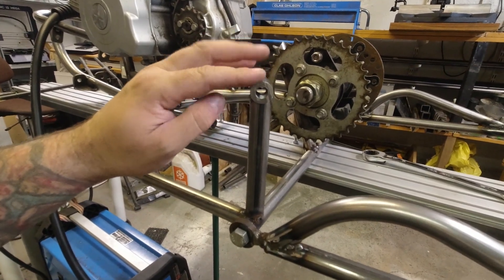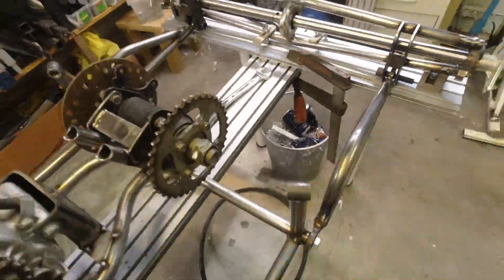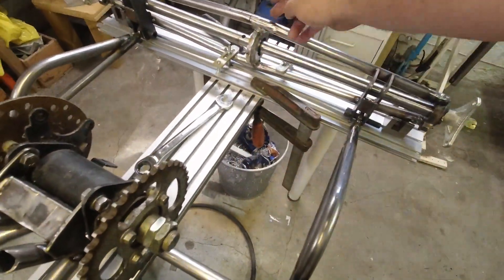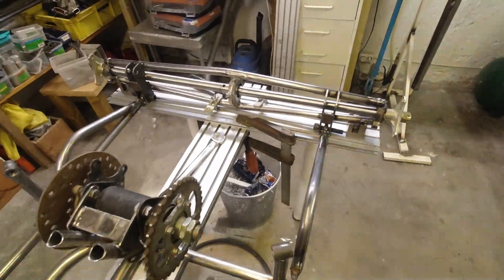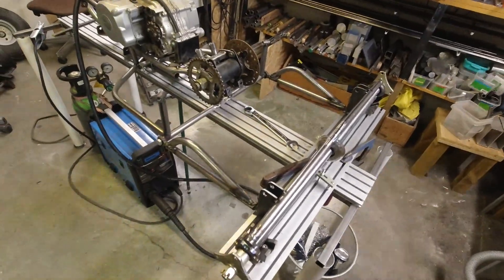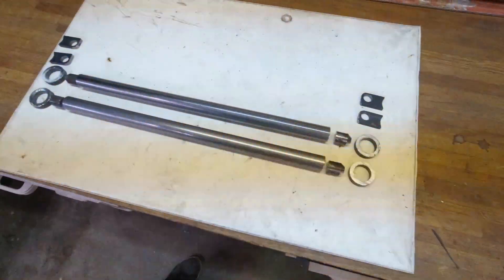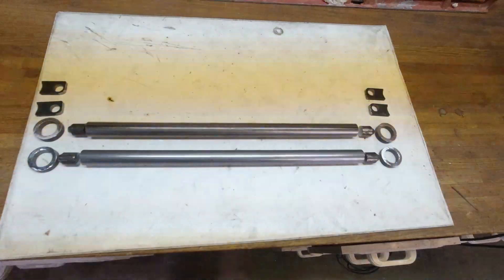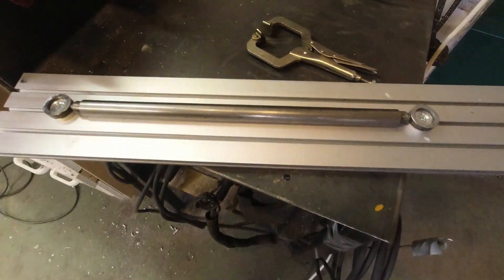The upper mount on the chassis, I just tacked it there to try it out — and there it is on the other side. I angled them almost towards the center of the rear axle. This is my first 4-link, so it's very exciting to see how it works. Now all the details for the upper control arms are made. I just need to mount the upper control arm in the welding fixture and then we're good to go — mounted in the fixture and ready for welding.